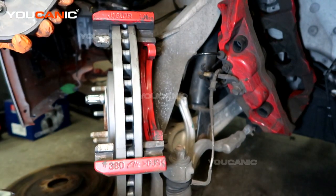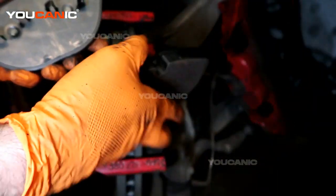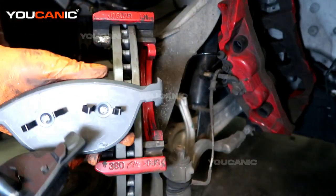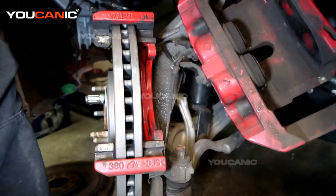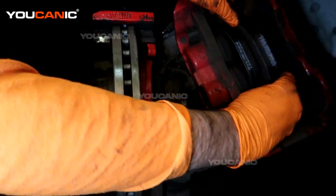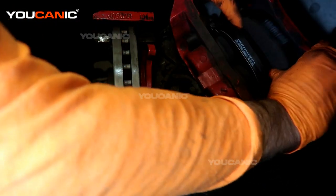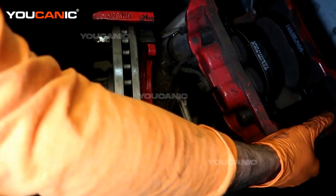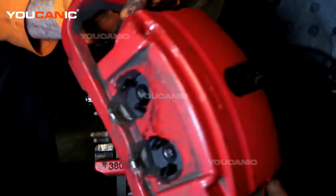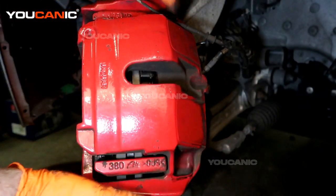You're going to find your new brake pads. We've got one with longer tabs on it — these go into the side with the piston. The ones with smaller clips go on the outside. You've got to kind of push them toward the back because of those long tabs, then be able to pull it in. Take the one for the front side and snap that into place.